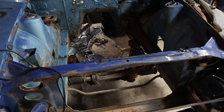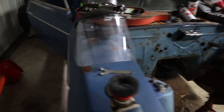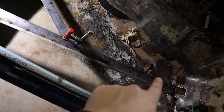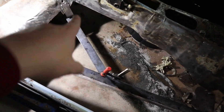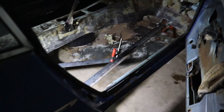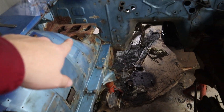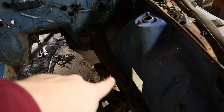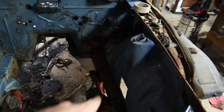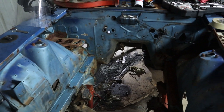All right guys, we are back the next day. Nathan's over there getting things prepared — cutting angle iron, getting it all ready. He's going to make all the cuts for each length so we can tack it all up, run some welds, and have the floor support done today. On my end, I picked up a new wire wheel and I'm going to wire wheel all the little stuff in here, clean up around the engine bay, measure up those rust patches, make new squares, and tack them in. We'll be good to go.